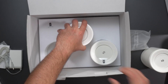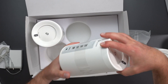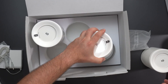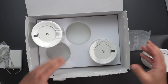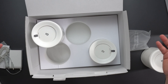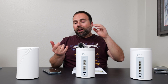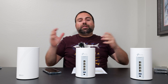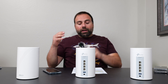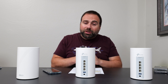The other two are actually exactly the same, with the same ports. All three of these are actually routers, but within the same network, only the one hooked up to your modem or ONT or DSL is acting as the router. The other two are automatically acting as nodes — this is done automatically in the Deco app. I set these up as my main mesh system, and this thing is solid. There were no drops, nothing abnormal, just amazing. Set it up, works perfect. I did get a chance to do all my speed test range tests, so let's jump straight in, starting with the internet speed test.